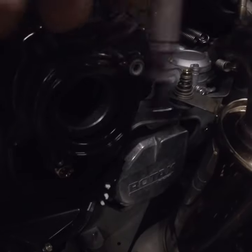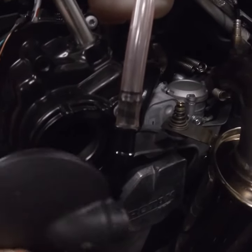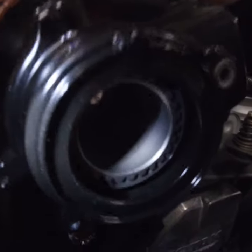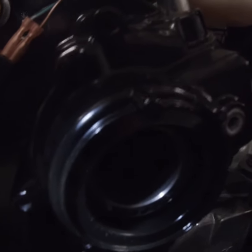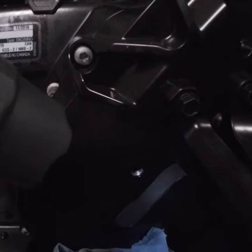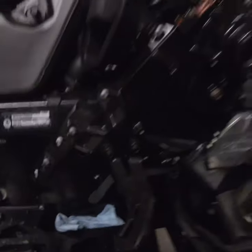There you have it — that's the fill tube, or vent tube, that goes into that rubber housing right here. Carefully pull that vent line off, then pry this back — it's got its own internal lip that snaps back in when you put it together. There is a slight gap between the outer rim of the chain case and that edge of the gearbox where you can put a small funnel in and fill right there. Go slow and watch the sight mark down here as you're filling. Also make sure you've already put the drain plug back into the bottom of the sled before you start these next steps, otherwise you'll just waste a bunch of chain case lube.